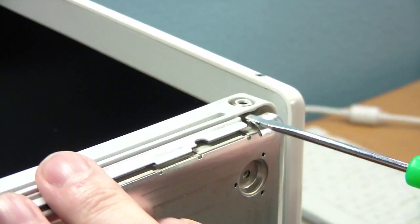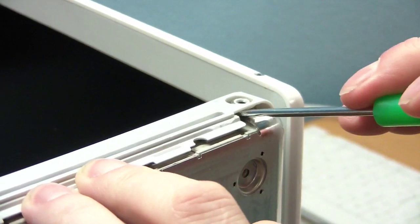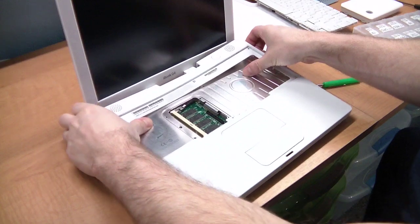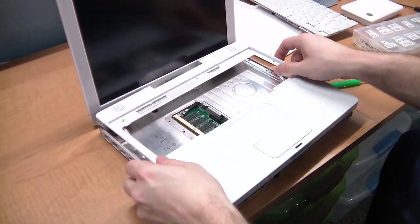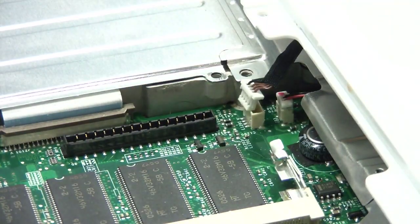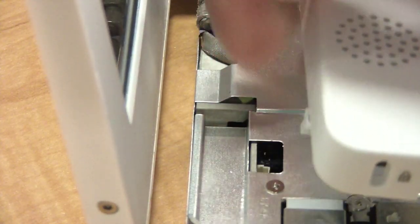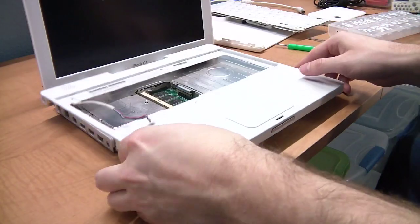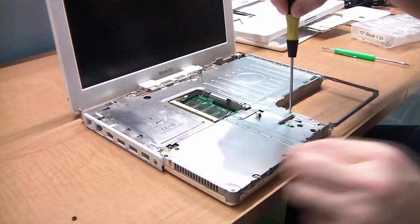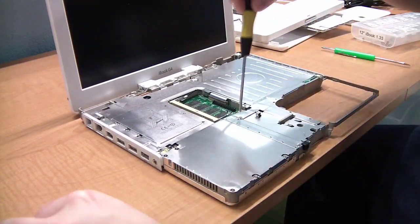Put the laptop on its side and locate the power connector. Watch this little trick. The top cover should pop off now, but there are three cables you'll need to disconnect. And the last thing to do is remove about 15 little screws from the top RFI shield.